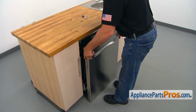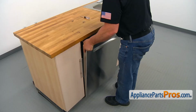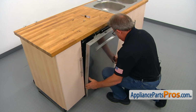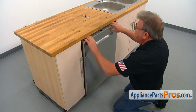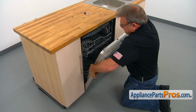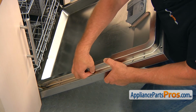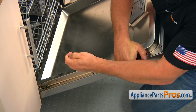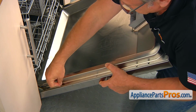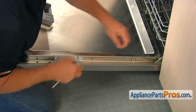All right. To install the outer door panel, we need to lift it off and put the inside strip on the top of the hinges. And then reach in and open the door. Support it on the sides and put your knee under. So I'm going to put 1 screw to hold the doors together, and a Torx 20 screwdriver, tighten it, and another one I guess would be better. We're going to put the bottom one too. And the one more at the bottom.